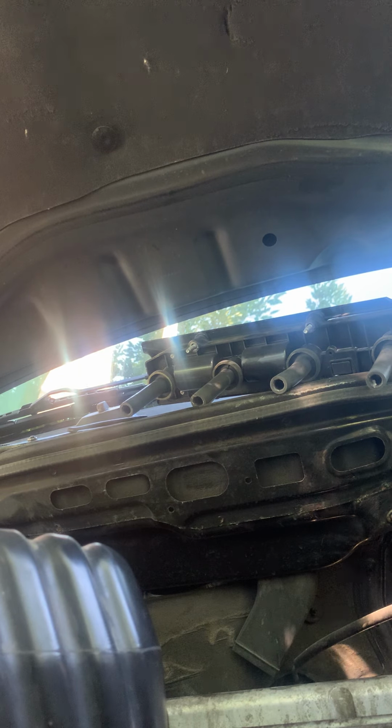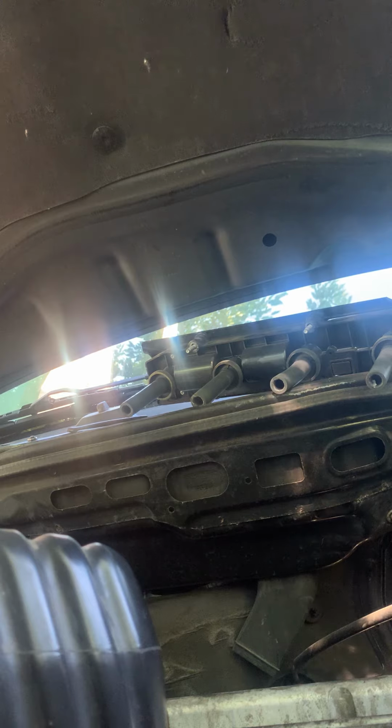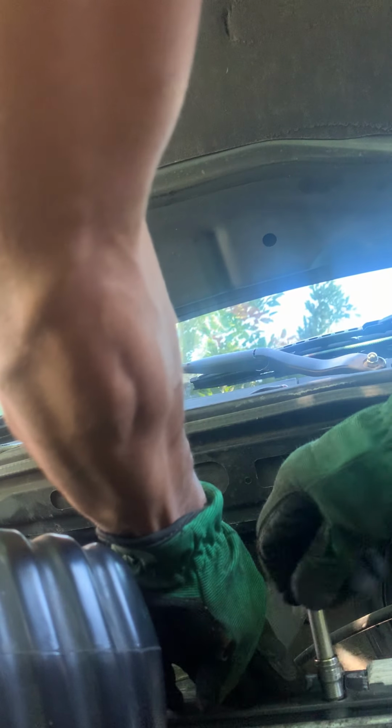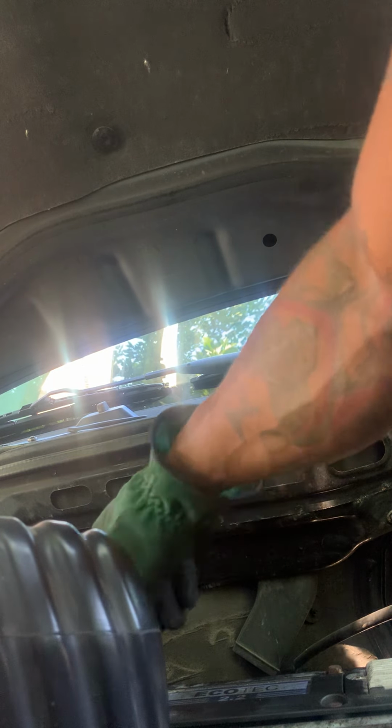All right. So now we're done with that. Now next, take our ignition coils, plug them babies right back in. Now, to get it to sit down, you gotta tighten it down. Tight to fit again. Don't try to overdo it or nothing. Once you feel like, all right, this is as tight as it gets, the first time you feel it. Not forcing it 3-4 times and then saying, all right, it's cool. Nah, don't do that. Because people I know messed it up like that.